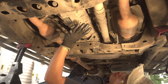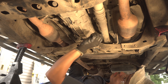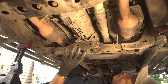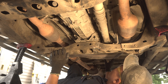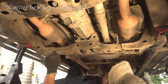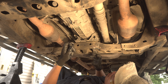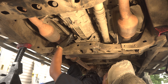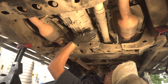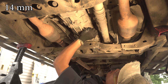So here we are under the transmission. In a previous video I did show you how to replace this, but I also told you to remove the front drive shaft. In this one I'm going to try to keep things as much assembled as possible. I have already removed the rear drive shaft for inspection. We should be able to remove pretty much all these bolts without having to remove too much — we'll test that idea out. The first thing I'm going to do is loosen all four of these bolts that hold the transmission mount onto the transmission — these are four 14 millimeter bolts.